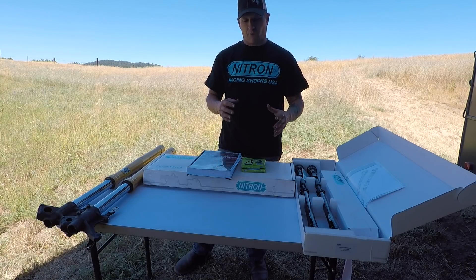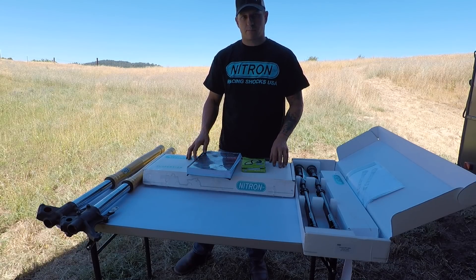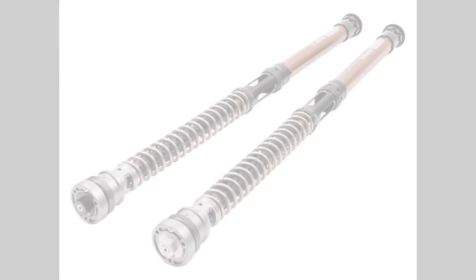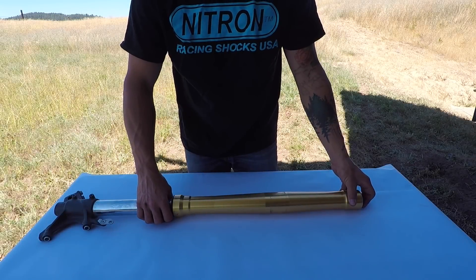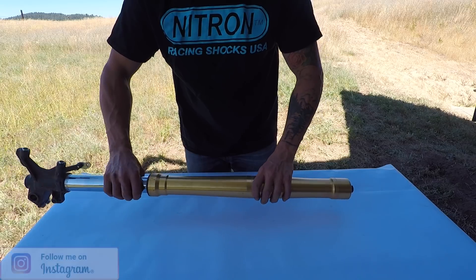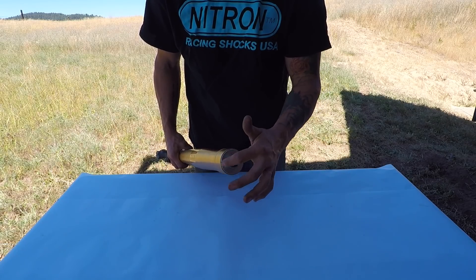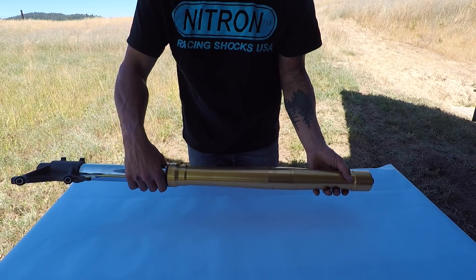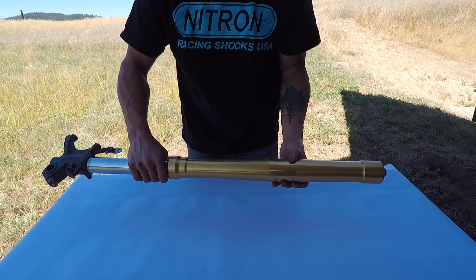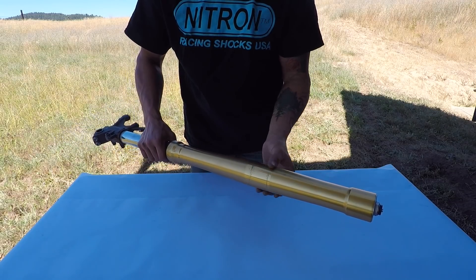This might freak out some people as far as doing suspension, but it's really not that hard. Hopefully this video eases your mind. So these forks are set up identical — they're exactly the same as far as the removal process goes. First thing we're going to do is loosen this silver nut here, which will loosen the cap. Then we're going to pour the oil out into a bucket or some kind of receptacle and dispose of it. Then we will disassemble the top cap from the cartridge and remove the cartridge inside.